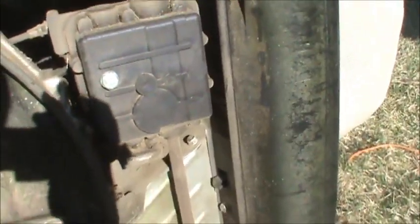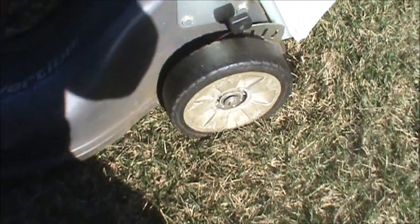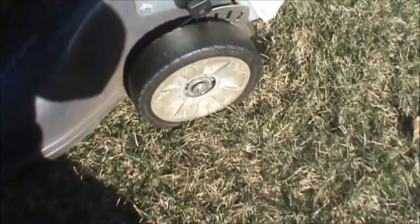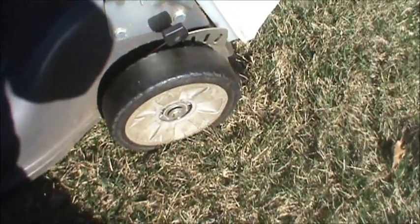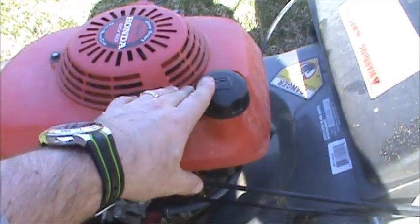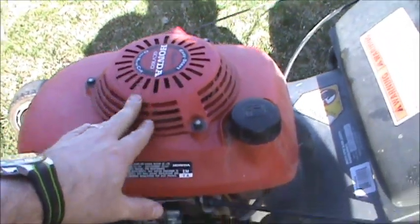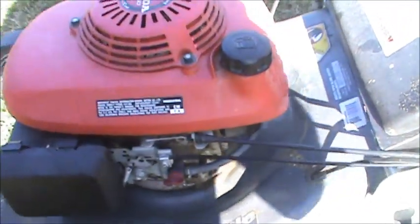Now let's take a quick look at the transmission. Looking underneath — I'm tilting it with the carburetor side up — here's the plug. There's no leaking out of the transmission, it looks good. I filled it with just a hair over four ounces. I actually went with the 5W50 synthetic even though they recommend 10W30 synthetic, just because it's a little bit thicker and I wanted to make sure it didn't leak. I put a plastic bag in the gas cap so the gas wouldn't leak, had the oil completely out of it, flipped it upside down on the grass, pulled the plug, and added the oil with a little syringe. That worked out pretty well.